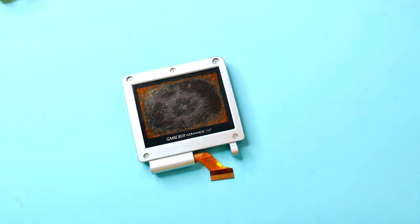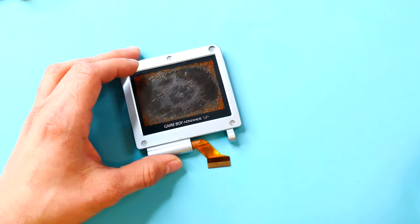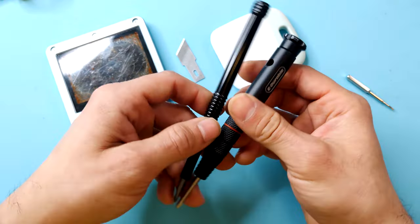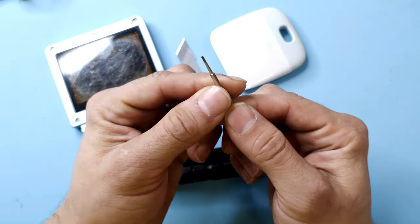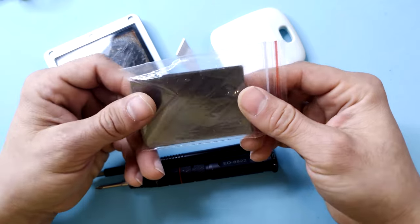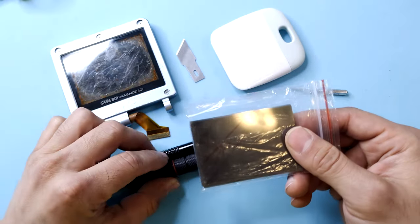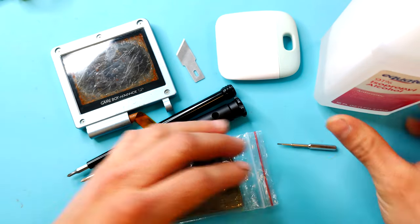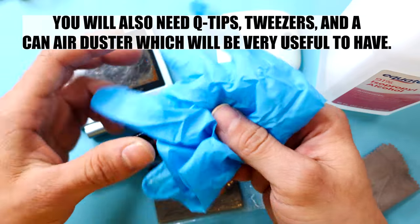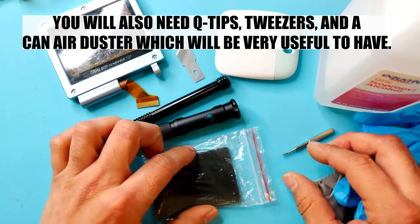I'm going to start off by explaining everything you'll need for this repair. First and obviously, a damaged Game Boy Advance SP screen, whether it has a screen burn or it's all scratched up. Then you'll need a knife blade, some sort of squeegee, a tri-wing and a Phillips head, and then a tiny flathead to pry the screen open, some polarizer films, which I will post in the description, the exact ones you'll need. You may have to input yourself which model you'll need. The one I'll be using will say backlight or highlight or something along those lines. And then you'll also need some IPA and some paper towels or some sort of wipes. Also optional is a microfiber cloth, and I'll be using some gloves since the screen I'll be using is pretty disgusting looking. So that's everything I can think of. I'll go ahead and get started.